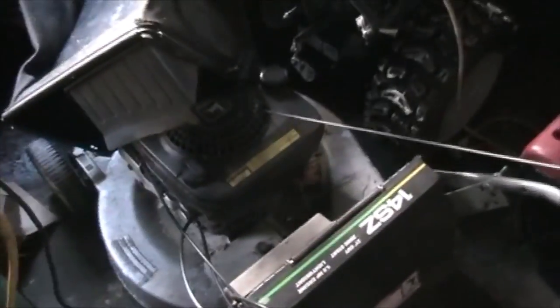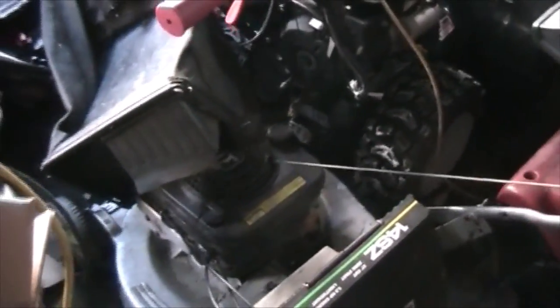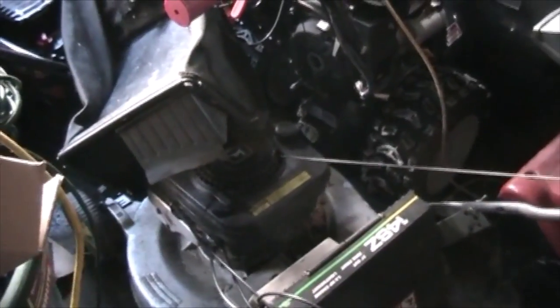And over here, this is a John Deere 14SZ with a cast aluminum deck — it's very sturdy. This is from the mid to late 90s. It's got a Briggs & Stratton Quantum engine on it, which is a flat head 190cc engine. This thing has a ton of hours on it but it still works. I have to clean the carburetor out on it today and change the oil. This one unfortunately does burn a little bit of oil, but it's got a ton of hours on it.